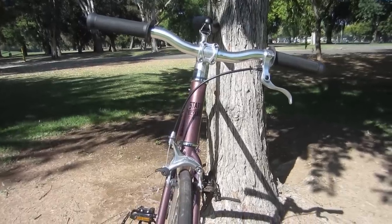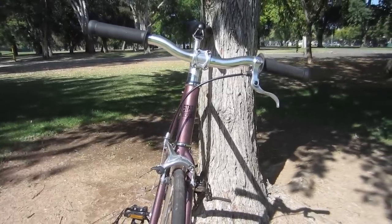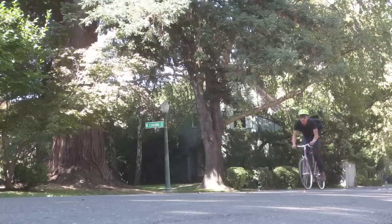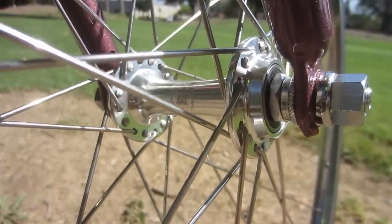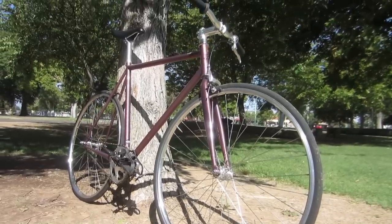With the 4130 Core Line, the steering was actually a lot more responsive and twitchier than I was expecting from a bike at this price. It is very responsive to steering at the handlebars and you don't really have to lean into corners as much — because of that I feel like I can ride this bike pretty aggressively and take turns a lot more sharply. So far I have not experienced any problems with pedal strike. This bike has low-pro box section wheels; a lot of other States come with those deep 43-ish millimeter wheels which will be heavier and feel more sluggish. With these box section wheels, overall the ride quality is pretty average — the wheels are fine, they corner fine, the bike is responsive enough.